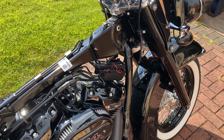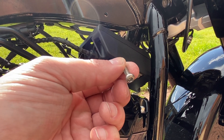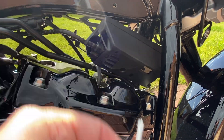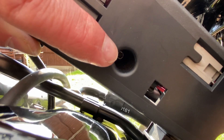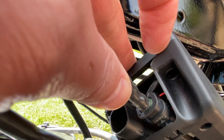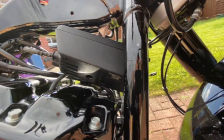To put this box back together it simply uses four T20 Torx screws — a simple Torx Allen key style tool is all you need. There's one screw up top, one in there, two more at the front, and one at the back. All four are the same size, and that screws the box back together.